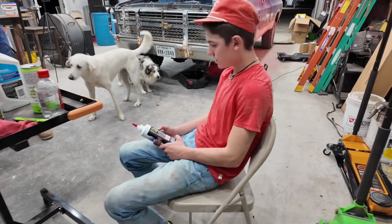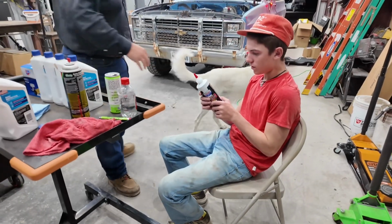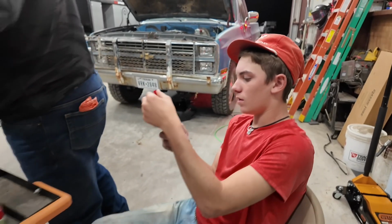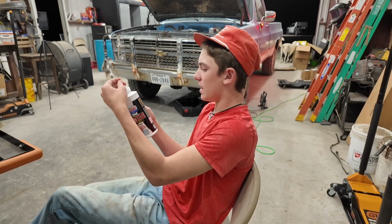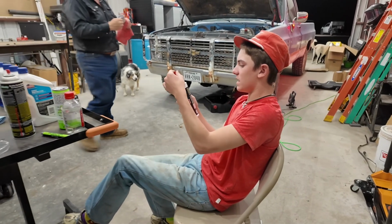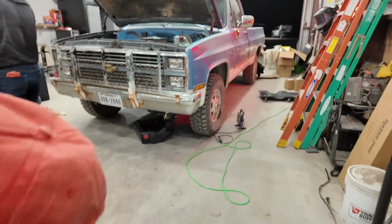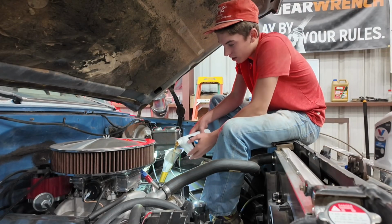Valve train protection? Yep. For maximum protection, use 1 full bottle with each oil change. Okay. Then what's it say? Not recommended for using in passenger cars requiring API SG, SJ, SL, SM, SN, and post 1994 vehicles. Well, you're pre 1994, so you're good there. May cause damage to catalytic converters. You don't have that. I do it this way so that it doesn't glug.